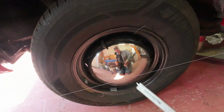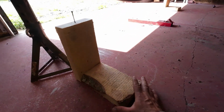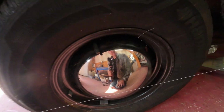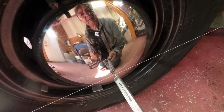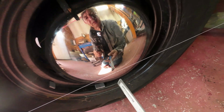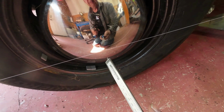That's 6.84 millimeters, so it's got to be moved in just a little tiny bit here. You only move it in part of the distance because the rest of the distance will be looked after on the front of it. That's about 1.93 there, so back out a bit. Once you get these things set, they're all right. But if you kick them, no good. See?